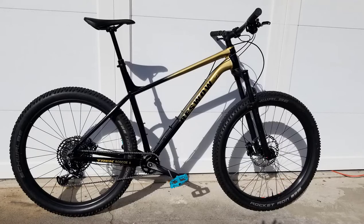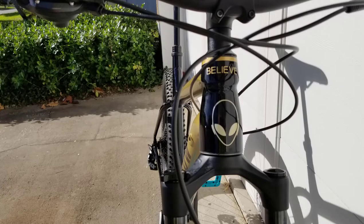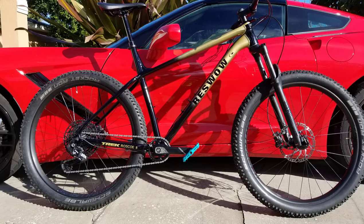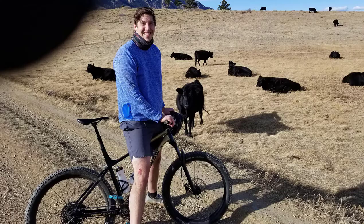The bike is curing in the house — I'm going to let it dry for a couple of weeks and then do the assembly. Here's the final product after the bike's been reassembled. The paint job came out really, really nicely. I've done three custom paint jobs and this is by far the best of the three. I attribute that to painting in November in Florida, which has the lowest humidity of the entire year — humidity makes such an impact. Here's Andrew out in Colorado on the maiden voyage of the bike around Christmas time. I hope you enjoyed the video and learned something — catch you on the next one.